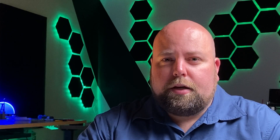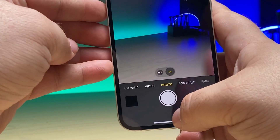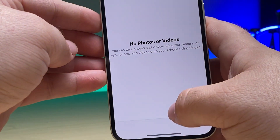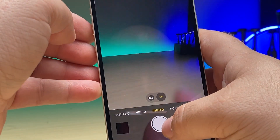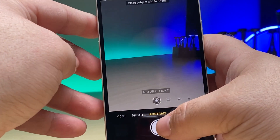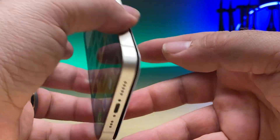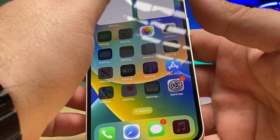The consequences are: apart from having issues with Apple Pay, when you're trying to take a picture with your flashlight, it won't actually be able to take the picture. The device might also freeze when you go into photo portrait mode, and the device might also restart. The iPhone 14 Pro and Pro Max don't have this issue because the flash flex doesn't have this IC on it, just like all of the previous models. It's just on the 14 and 14 Plus.